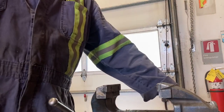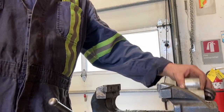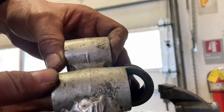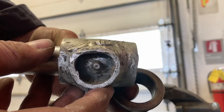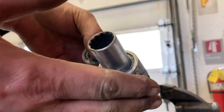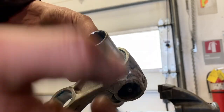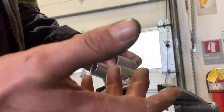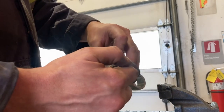Just working on the RM again. This project's taken way too long. But anyway, what I've got here is the linkage bearings. I've made this one greasable. I had to weld a piece of aluminum around because once you slide over a rock or something, it's not going to tear the grease nipple out. I like to have it in the bottom because it's accessible. The option would also be to make the bolt greasable.